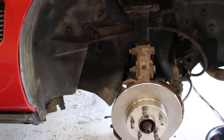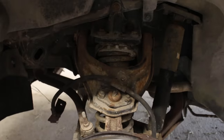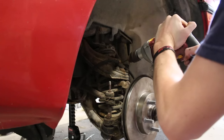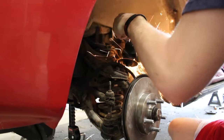The back ones were unthreaded and had the bracket removed from the frame, but the front ones were a bit more tricky. There are rivets holding them in place on the control arms, so those need to go. I did try drilling them out at first, but I kept breaking bits, so I decided to just use my angle grinder with a cutoff wheel to take care of them.